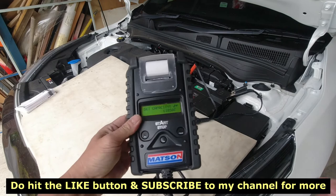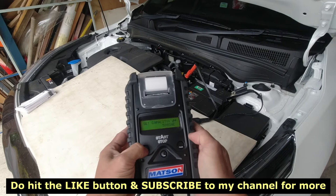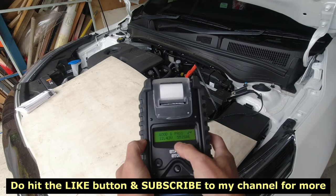So I'm going to change the capacity to 550 by pressing the back to reduce it. 550 there. I've got 550 now. Press enter. And it's begun testing. Great. It says good and pass, 12.43 volts. Actually, it's got 552 SAE. Fantastic.